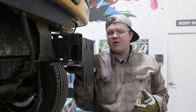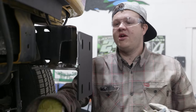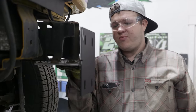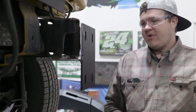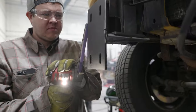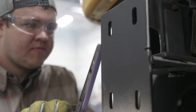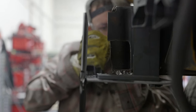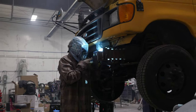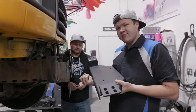At a later time I'm going to make a fish plate that goes on the outside of the frame, because this is going to be my pulling point with the winch. If this thing ever gets stuck and you need to winch out, you've got to have a solid mounting location for your winch to pull from. We're going to be fish plating about eight and a half inches on the outside of the frame rail, tying it all into the winch plate so that when you pull, this thing is stout. Then we'll get it all welded in and move on to bolting the bumper.